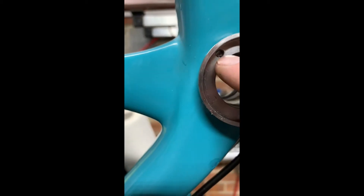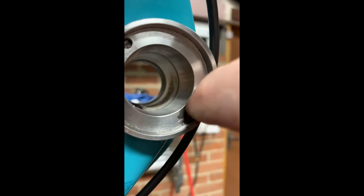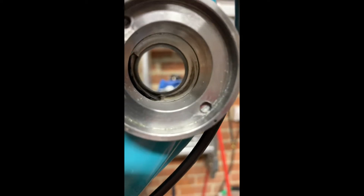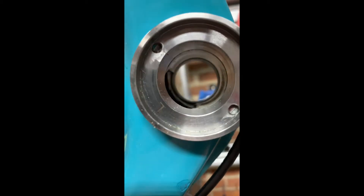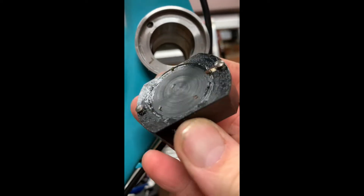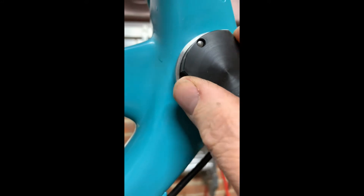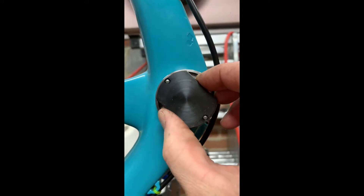Those little pieces of metal that got compressed up — I just had to get a Dremel on and take off the little pieces that were lifting up. I've just dremeled them off slightly. As you can see, the holes in there have some compression marks. This tool could do with deeper pins or harder material. It also says to torque it to 40 newton metres.